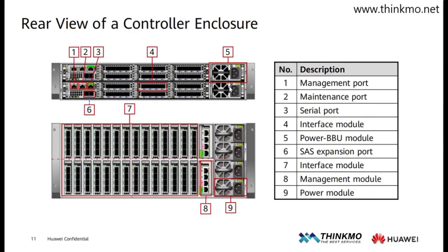As for the redundancy design here, this is how we do it. The main redundancy here includes the power supply. As you can see, these are 2 power supplies, and here directly there are 4 power supplies. 2 power supplies here, and 4 power supplies here. Isn't it 2U, 4U? Mainly for what? For redundancy. Including backup batteries, it's the same. Each power supply has its own backup battery.